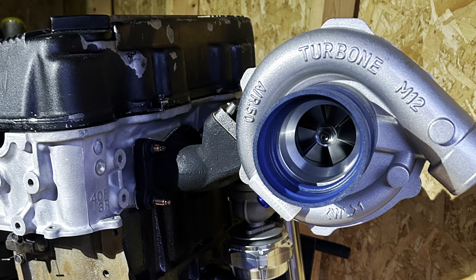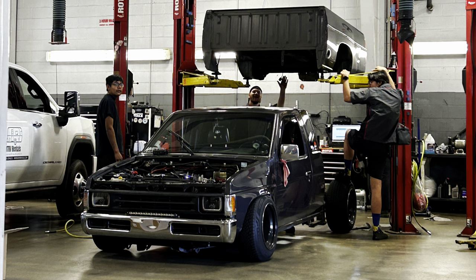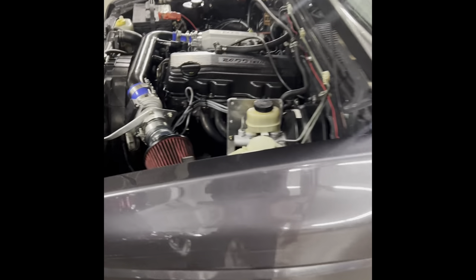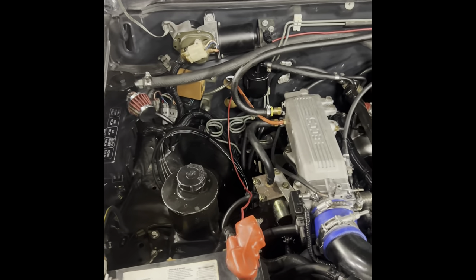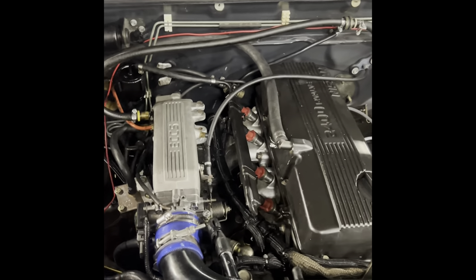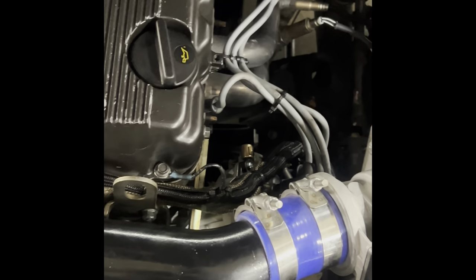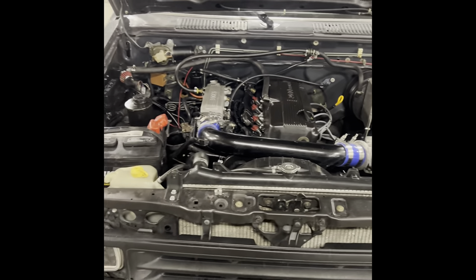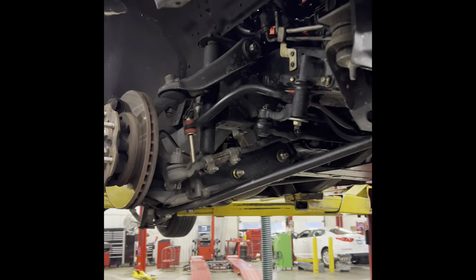Here you can see what you can do with a big fuel pump and an Apexi Neo. I have a piggyback ECU — the Apexi basically taps into my MAF signal wire, interrupts it, and spits out a different percentage based on my input back to the ECU to trick it into sending more fuel. With these two mods I'm able to max out my injectors, which are 370cc stock size. When I run a turbo I'm going to try about 7 psi on a good tune, pulling the proper amount of timing. This pump is also E85 compatible as long as your lines, fuel pressure regulator, and injectors are compatible, and you have some way to tune it — keep in mind E85 runs a lot richer than pump gas.